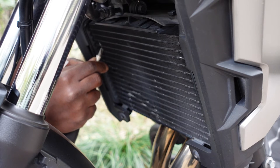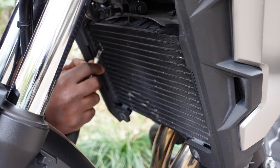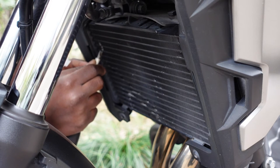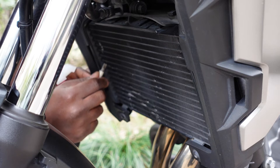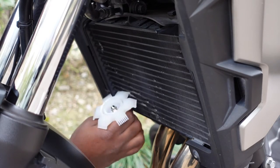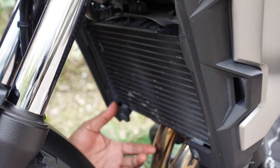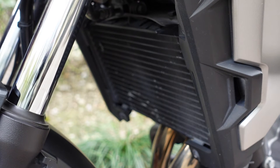Some parts are really badly damaged, but with some patience you can get in there and get them all fixed. If I can just grab one side of each column — maybe the top or the bottom — just enough to allow the tool to fit, then I can drag it up and down to get them straightened up. It looks like I can't get it completely straightened out like original, but as long as the radiator still works perfectly, I think I'll just go ahead and install the radiator guard.